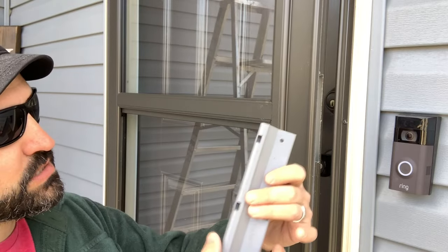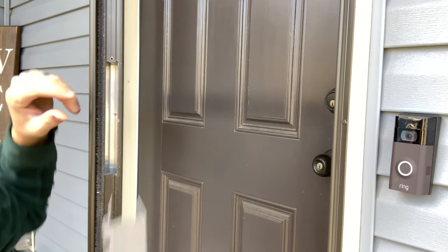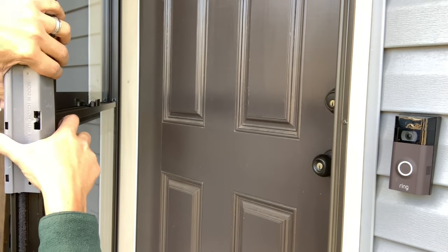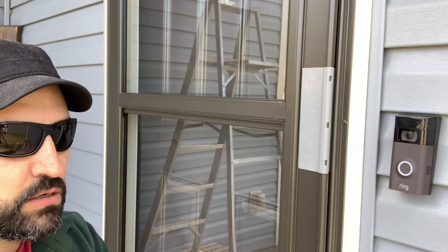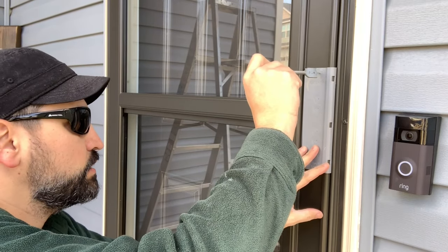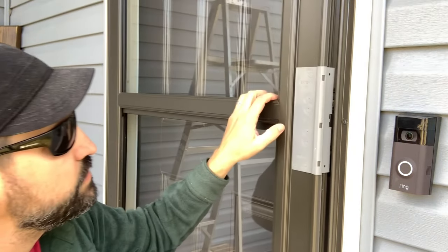All right, here we go - setting up the door handle. I came with instructions on how to do this and I've never done this before, so I pretty much have one shot at this because you have to drill multiple holes through the actual aluminum. It comes with everything you need, so I'm pretty excited but also a little nervous. It came with a template - this little plastic thing. There's a notch right here and there's a notch right inside the door - it just goes on there so it won't go up or down. Comes with a three-quarter inch hole bit, which is really nice - just line everything up and that's where we're going to be drilling.